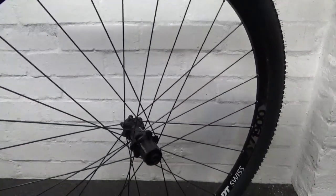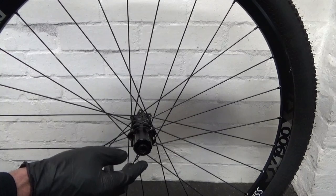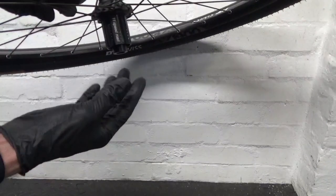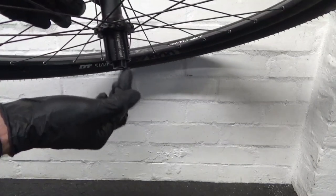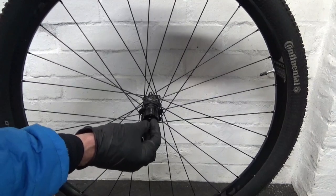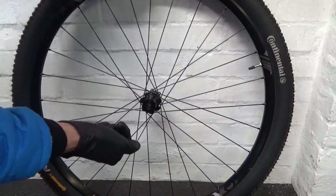What you want to do is remove your freehub body. If you've regularly serviced the wheel before you should be able to get hold of it and pop it off, but normally the end cap is holding it on so you can't pull it off. You can either clamp onto the end cap in a vise with soft jaws and pull up on the wheel to pop it off, or if you've got a cassette on there, loosen the lockring slightly, put your hands behind the cassette, and lever up to pop the end cap off.